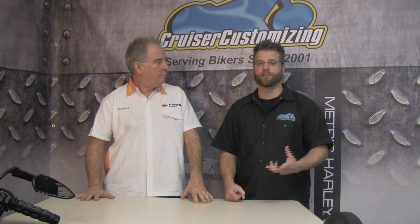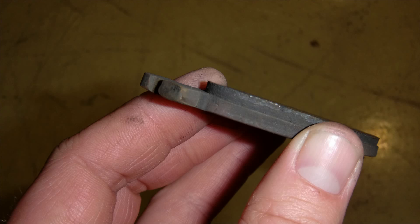One thing I strongly suggest: every time you change your tire, take a look at your brake pads. If they're more than half worn, go ahead and put new brake pads in — then you know you'll be good until your next tire change. Brake pad material doesn't have to be all gone before the pad is no good. When they start to get thin, heat transfers more and they become less effective. Do not try to get another ride out of them.